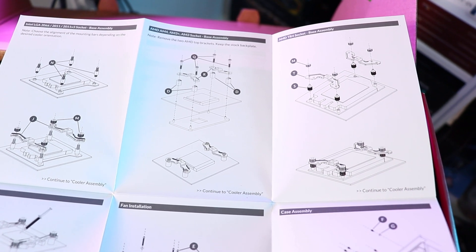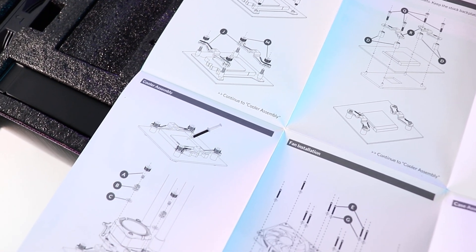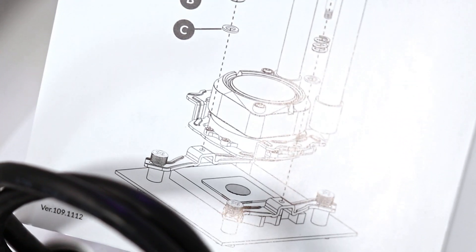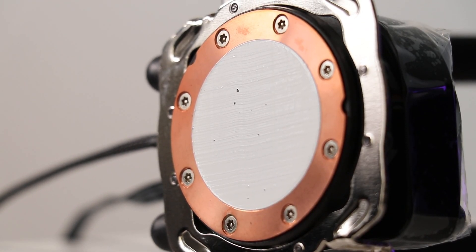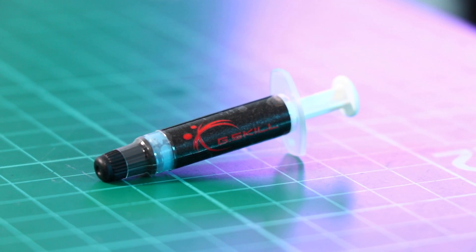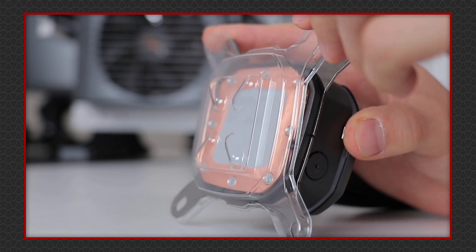The manual is small and concise as all manuals should be, but there's a thermal paste moment in the making here. You've got guidance to use thermal paste on your CPU before installing the block, but there's pre-installed thermal paste on the cooler already. Hopefully that doesn't catch out too many newcomers — FYI you only need one or the other, not both. It's nice to see additional thermal paste included alongside the pre-applied stuff. After retesting all the AIOs I've got to hand, I got caught out by Corsair since they didn't include a tube of thermal paste with their pre-applied paste, so the H150i Pro XT had to use MX4.